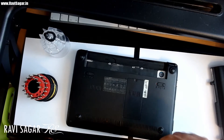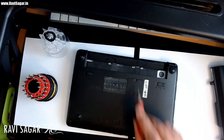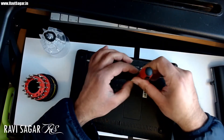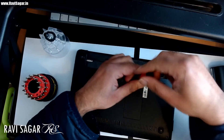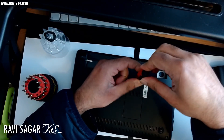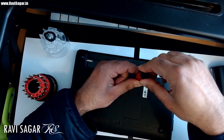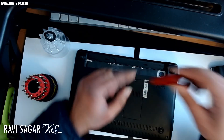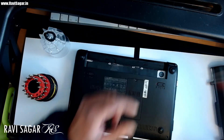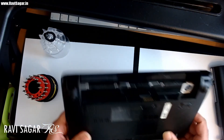For this particular netbook there are usually four screws on the back and one more screw inside the panel right next to the RAM. You can then flip the laptop to open it fully, but we won't do that today. Whenever you get a chance, clean the inside as well, because dust around the fan area can affect performance. As you can see, this machine is in very good condition for its age.